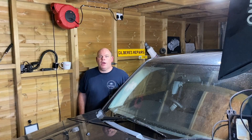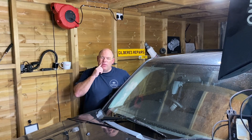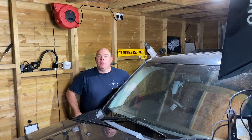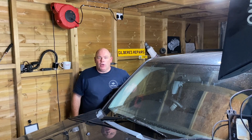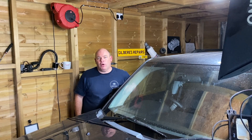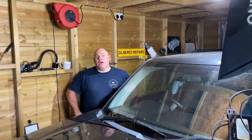That went a little too easy — they don't normally come off that easily with the nuts. I think they were previously greased. If you refer to some of my previous videos, I think the Ford Ka video — I'll put a link in now — that's what can happen: you've got to cut them off with an angle grinder. So before you even start this job, have an angle grinder with a cutting disc available to you, because that's the normal end result. If you found this video useful and informative, please like, subscribe and share, and I'll see you next time.